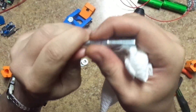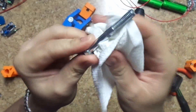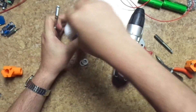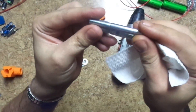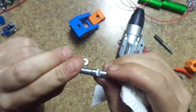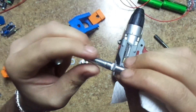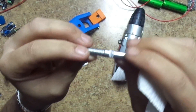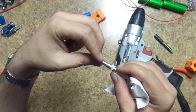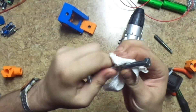There are a little bunch of metal shavings in there. It started off just like this bolt, and put a nice little hob in there just using a tap. That's how I've made all of my hob bolts since I bought my first eBay little thing to put on the motor that didn't work at all. After that I got a tap and was able to print an older version of a hob bolt maker — that didn't quite work so well. Finally I decided to make this because I just wasn't getting a good clean hob on there, and this one looks pretty good.